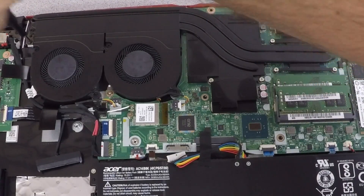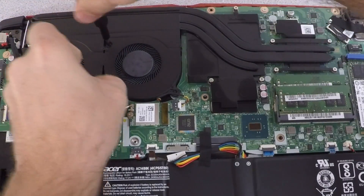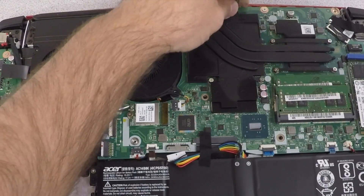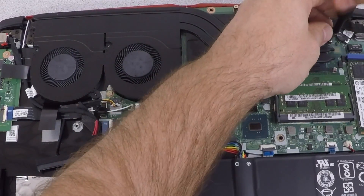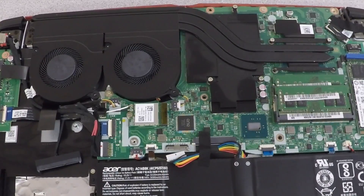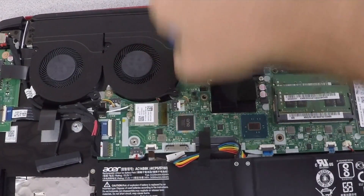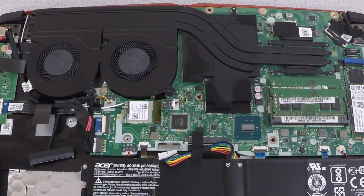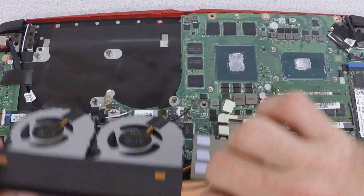After you remove the battery cable, go ahead and remove the screws that hold in the heat sink for the GPU and CPU. Remove the four fan screws and put them in their own pile since they are different from the other screws. Then remove the GPU screws and the CPU screws, putting them in their own piles. When you remove the heat sink assembly, pull from the top left corner, gently flip it over onto its other side immediately so you don't detach any cables.